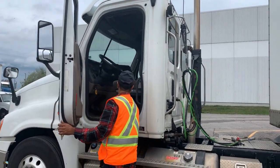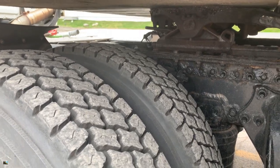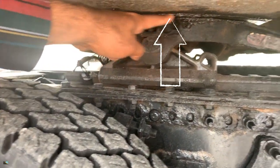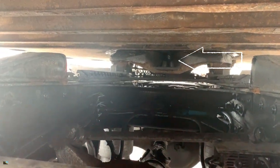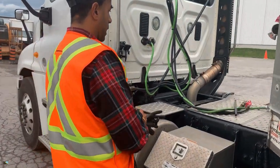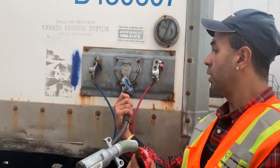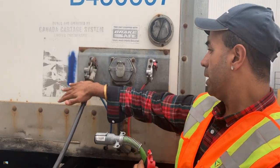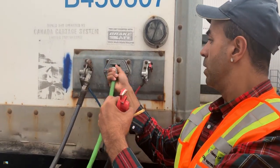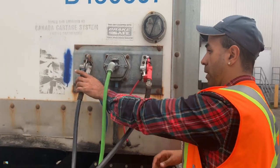Come outside and check your fifth wheel handle — make sure it's in the locked position and there is no gap between the fifth wheel and the upper plate or the trailer. Then go under the trailer to check the jaws: the jaws are in the locked position. Then reconnect your airlines: service to service, blue to blue — don't put blue to red. Put in the electric line, then supply line to supply. Make sure all of them are connected properly.